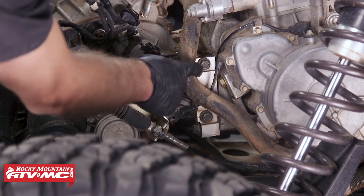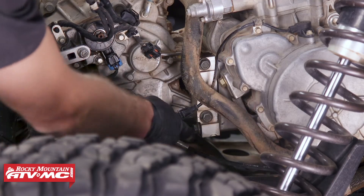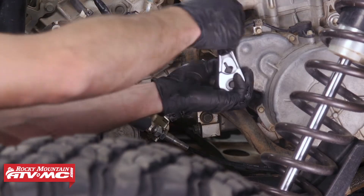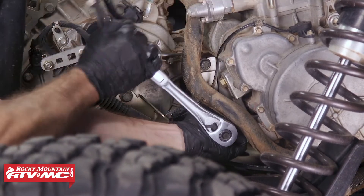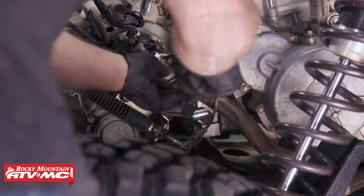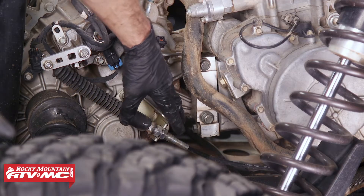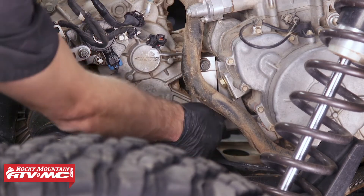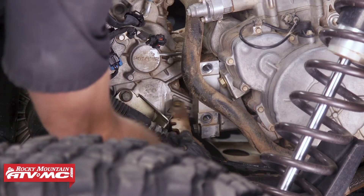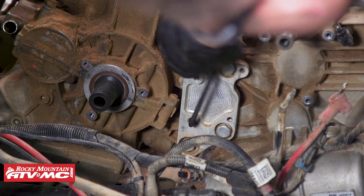At this point, start loosening the motor mounts. On the back passenger side, loosen the two bolts — don't need to remove them all the way — and remove the two rear bolts all the way. If a bottom bolt doesn't want to back out, it may be dirty, so take a better look once the motor's out. You may need to take the two side bolts out instead; note there's a bracket on the other side of the transmission that will drop down when you remove those bolts. On the driver's side, there's the SDI motor mounting plate with set screws — back those off before removing the four bolts.